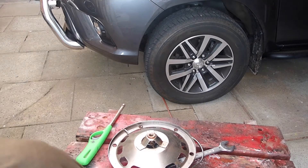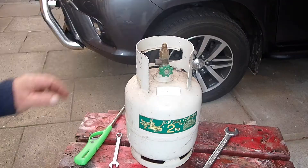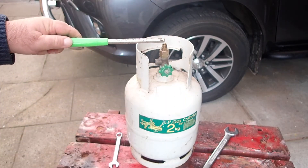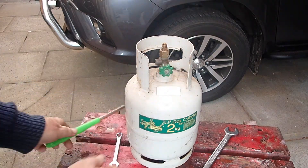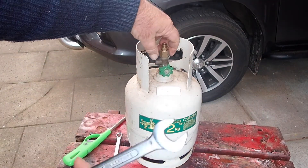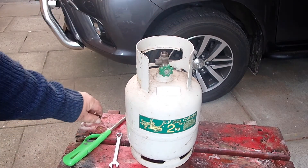The seal's good. I'll test this by putting it on the gas cylinder and checking for flow. I've bolted the jet unit onto the cylinder, cracked the valve, and I can feel the gas flowing out - don't do this at home, kiddies. It's actually coming at such speed it won't light, but we can eliminate the gas jet. So the jet is out of the equation, the cylinder we know is good.